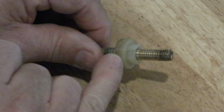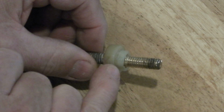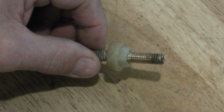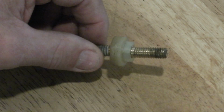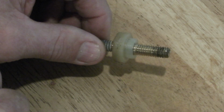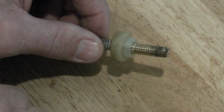So this is the stud. This insulator here, you have to insulate the stud because that plate that holds the rear bulkhead connectors is what the rear bulkhead bolt that grounds almost the entire vehicle is attached to. And then from there it goes over to the frame underneath the coolant expansion tank. So you cannot have these positives touching that plate, the mounting plate that holds the bulkhead connectors, or you get a dead short. So that's what these insulators do. They insulate this stud from the plate.